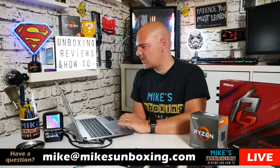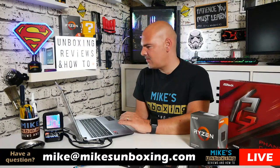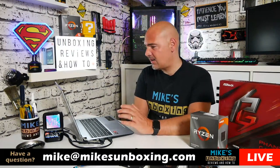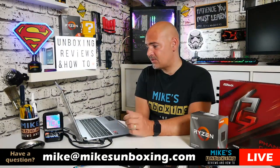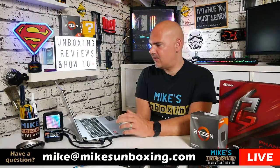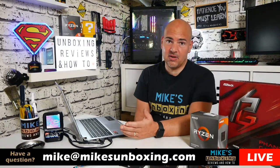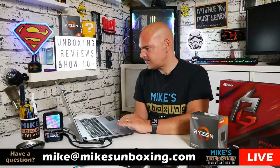The Freckle Puny says, was holding out for a Ryzen 3 3300X to pair with my ASRock B550M Pro 4. Still not in stock here in the UK. Went with an R5 3600 instead. To be honest with you, when you're looking at the 3300X versus the 3600, especially price-wise at the moment, if they were at their original prices, I think you'd be fine. But I think it's like a £20 or £30 difference between the 3300X, if you could get it, and the 3600. I think that's money well spent.